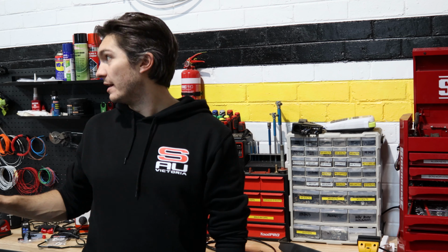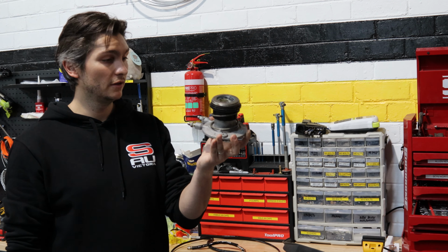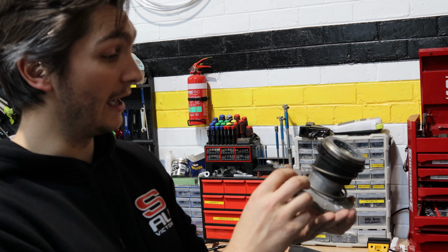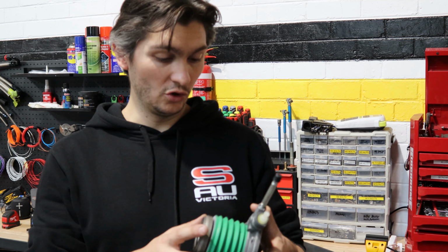Now I can focus on the gearbox. Next part of the TR6060 conversion is the clutch slave cylinder. So this is my old T56 clutch slave, which made it a bit easier because the fitting going into it, or the housings for it, were threaded. Unfortunately, for the new one, they run a VF slave. Not too big of a deal.